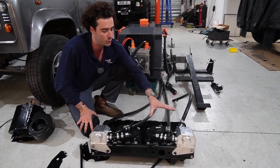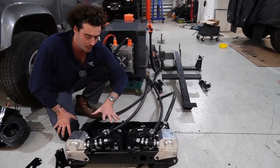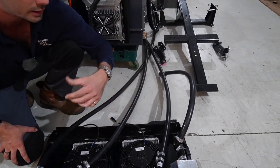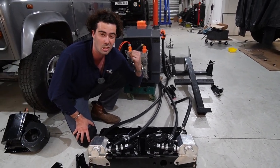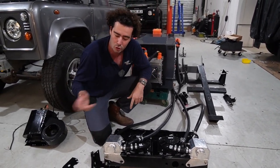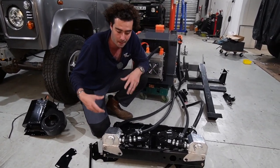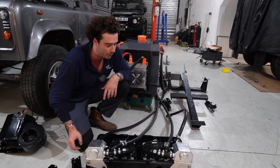The reason that there are two is that one goes to the battery pack, which is this one, with a little sort of slow pump, and then the other side goes to the motor, which is the much longer pipe work. It's got to go all the way to the back, and the pump for that one is right down the back of the car because it's as close as possible to the motor. It's super fast, super high power, so in here it sort of froths up and gets really excited. But that's important because that means that plenty of coolant is going around the car.